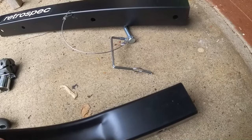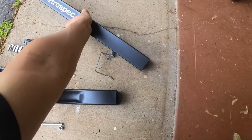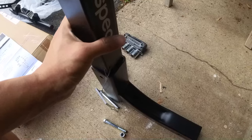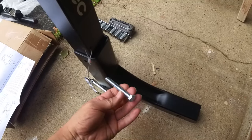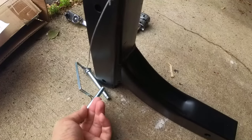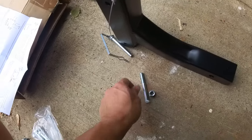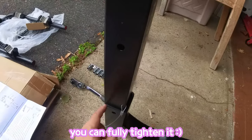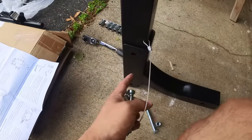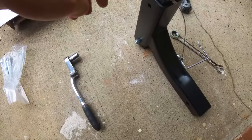And here is what they call the hitch insert — it's L-shaped. I think the dent on it prevents it from going all the way inside when you insert it into the two-inch hitch. Pretty easy — you just insert it like this. Then using a 3-inch bolt with a 14mm nut, thread it all the way through. Do not fully tighten it yet. Once you insert this, lower the mast away from the L-shape, then insert the cable tie bolt into the middle part.